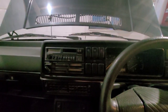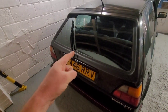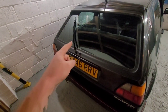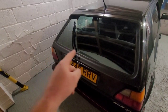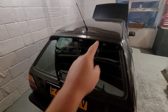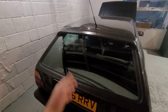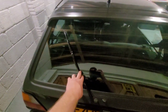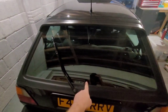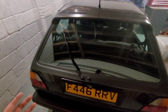Now we need to go to the back of the car and have a look at what we've done there. The back of the car is looking more original, and I'll tell you for why - it's the wiper. Mine was laying flat; it's a modification you can do which means moving the arm around so the wiper lays different ways, so the wiper goes flat. From the factory they were like that - a couple of reasons whether they're true or not: airflow, aerodynamics. Mine possibly needs to move that way a little bit more but that's as far as it will go, so when it comes around that way the wiper blade is not actually touching the rubber - so I could have the wrong length on there.